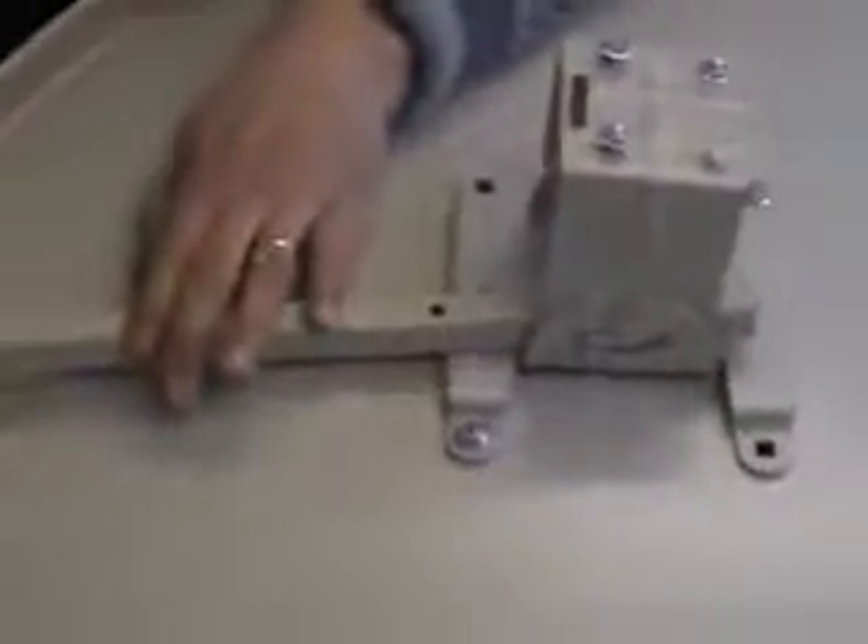The next thing we do is simply slot the arm. The hole at the bottom indicates the bottom of the dish. Looking at this bracket — it's already threaded — so we can simply get this bolt, put a washer on it, and slot it straight through. A 10mm socket or spanner is enough to drive this down, and we simply repeat the process for the next nut. A second nut would simply be slotted through here.